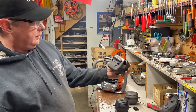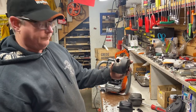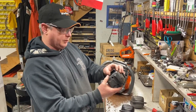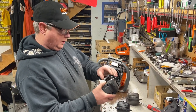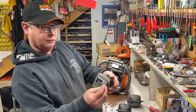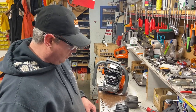Here's a standard one. I take a uni bit and cut a hole on each side with a 7/8 hole. Then I weld the 288 caps — I braze them on. I don't weld; I don't know how to do that very well, but brazing has always worked for me and I've done absolutely thousands of mufflers. Everyone on the coast has mufflers like this. I weld the cap here, cap on this side, then slide screens in for forestry safe. If you don't have to have the screen, you don't have to, but most people do here on the coast.